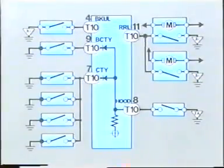You can tell which one is causing the problem by measuring the voltage at each of these switches with all the doors closed and the ignition switch set to the on position. Let's begin with terminal BKUL 4T10 in the luggage compartment door key operated switch circuit.